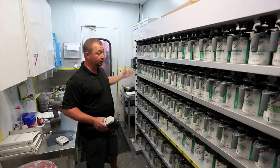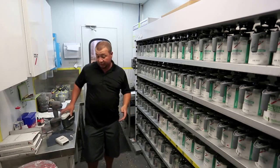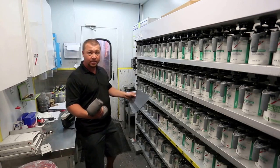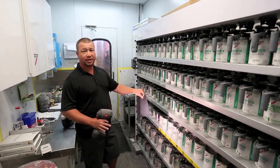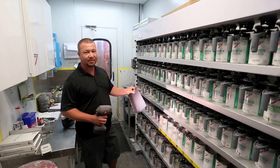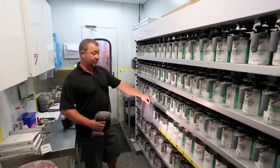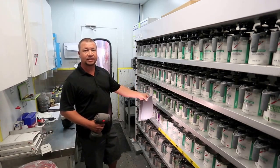So then I'm able to pick that color, it tells me what's in it, and then I take it out and spray one of these panels to make sure that it's close to the car. And then what we have here is this is called a sun gun. This light is the closest light to the sun — most lights have yellow or blue, but this light is 97% exactly the same as sunlight. So I can look at it even though we're inside, or if it's dark or if it's snowing — this light lets me know what your car is going to look like outside, and that's the true color: what it looks like in the sun.